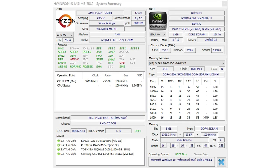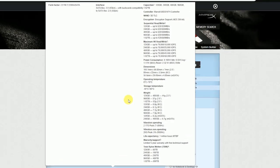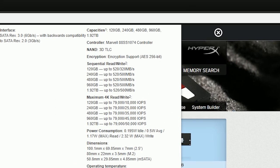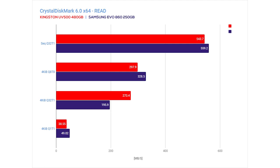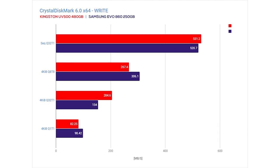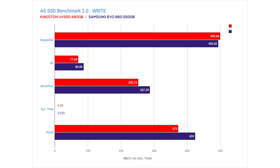Now let's move on to the benchmarks. For the first set, I'm running this using my new Ryzen system with these specifications. Our 480GB variant is rated at 520MBps sequential reads and 500MBps sequential writes. Looking at our Crystal Disk benchmark, we were able to easily hit and even exceed that at 543.7MBps read and 531.2MBps write, which is always a nice thing to see. I've also tested it on AS SSD benchmark, which tests an SSD without using the system cache. The Kingston UV500 was still able to run at decent sequential read and write speeds, as well as 4K random operations and the total time to access the entire drive in one full stroke.